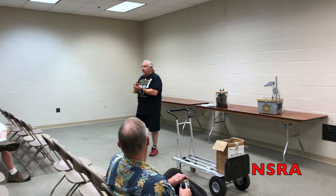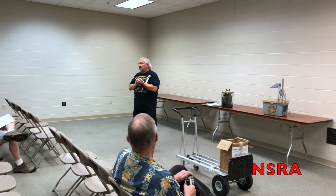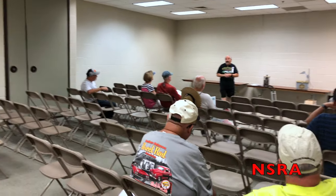So I get a lot of people going, well, what can I do without spending any money? Okay, keep the battery charged up. If you're going to just use the premise that you can start the motor or drive to keep your battery charged up, you've got to do it long enough that you fully charge your battery. Not partially charge your battery, you want to fully charge it, or it doesn't help. It's not good for the battery to keep it partially charged. Now, it might be good for the motor and all that kind of stuff. That's great, but you're not going to prolong the life of the battery.